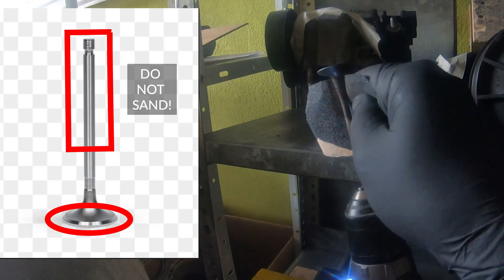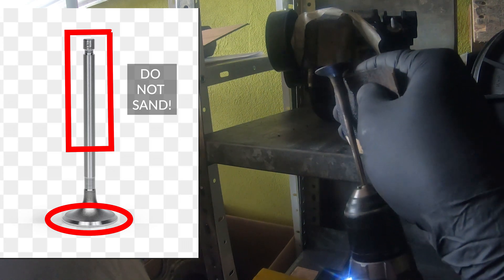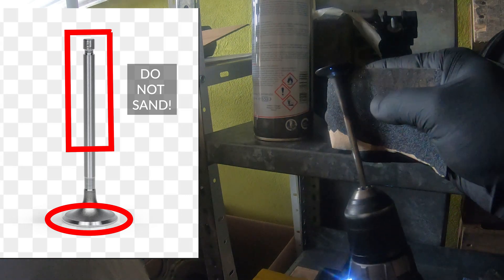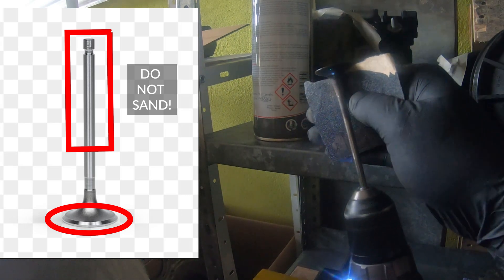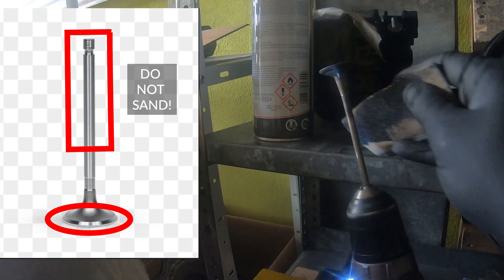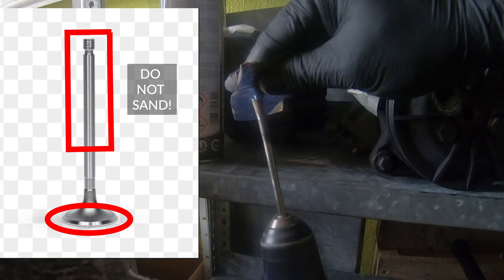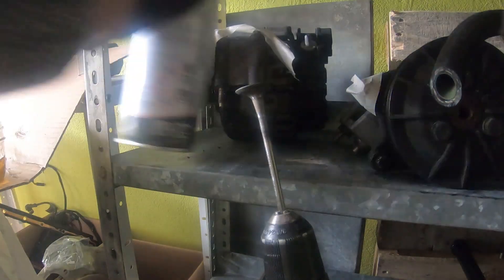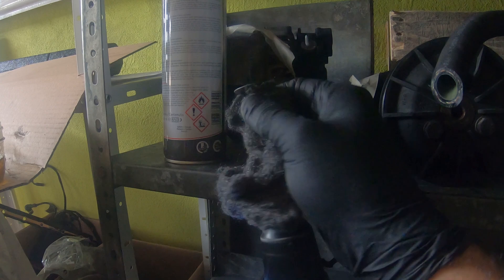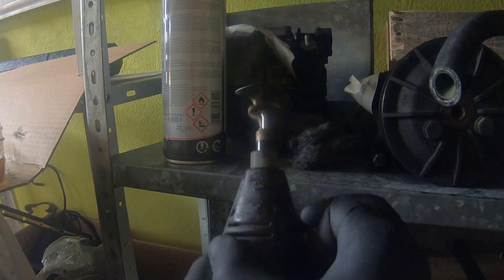I just wanted to jump in here and say be very careful not to grind on the valve stem itself — just get the carbon. Do you see the black part on the stem itself? That part is not touching anything when it's in the head itself, so you can grind away that part. Do not grind the ledge of the valve seat or the valve stem itself, because it can really screw up where the valve sits in the head. There can be extra wear in there, and then your valves will be banging around and you don't want that. So just clean off the parts that you need to and leave the rest, especially if the valve is straight. My valves were all good to go, and I then use the Dremel to polish everything up and make it look nice and clean to get all the carbon off.